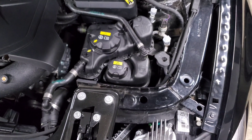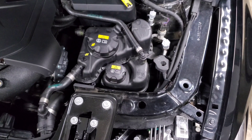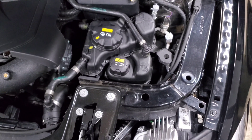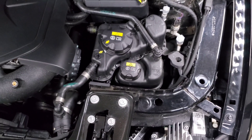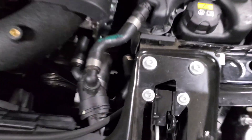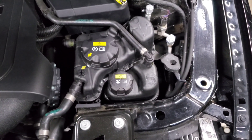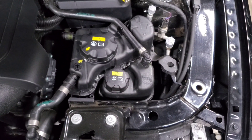This circuit only has one electric pump so it's pretty simple. First, top off your system. If you have the BMW tool to vacuum fill, that's great, but most people don't have an air supply, so you can skip it. It's nice because it puts a vacuum on the circuit and pulls coolant in to evacuate air, but you can do the manual process to get pretty much the same effect. Once topped off, I recommend squeezing some of the hoses to manually get air out — reach down and squeeze this line and it'll start creating bubbles and you'll hear it sucking coolant in. Keep doing that until it's filled up as much as possible.